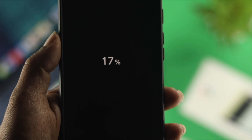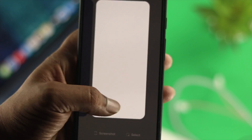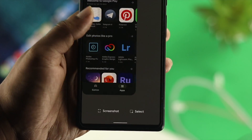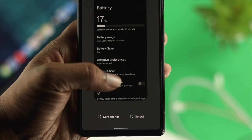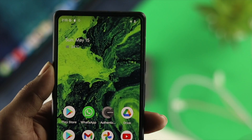Here's a bonus tip for everybody. If you're running too many applications in the background of your Google Pixel 6 and 6 Pro, your device is not going to charge very quickly. All you want to do is go ahead and remove all background applications that you're currently running — remove them one by one — and then go ahead and charge your device to see if that works.